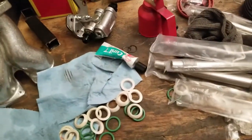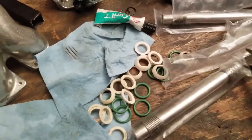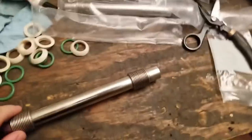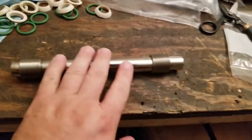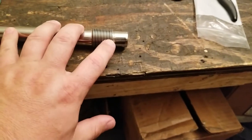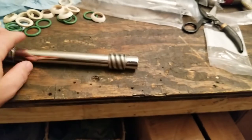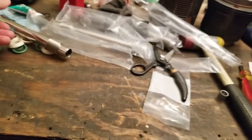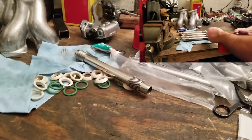So I've got some extra o-rings. Let's take one of these bad boys and open it up. I'm going to do this one-handed. First off, they're stainless steel and you can see that they are longer at this end. That's supposed to help out with the oil and the transfer of the oil back into the actual crankcase. It also helps it stand up whenever you go to put your cylinder head on. You guys that have put one of these things together before know what I'm talking about — how the push rod tubes keep falling — well, this helps out with that, so that's kind of cool.